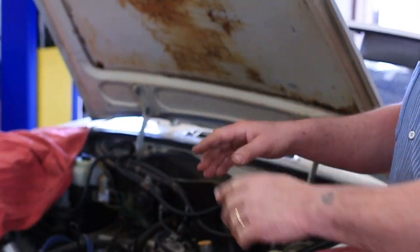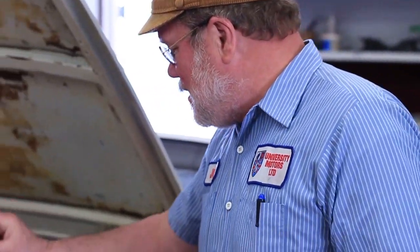You'll remember in an earlier video that I told you that anytime you take the cylinder head off, to put the pistons halfway up their stroke and pour in an amount of fluid on the top. Gasoline works best, but you should never use gasoline for stuff like this because it's dangerous, but gasoline works really well. So we put a fluid, unnamed, into the top of each of these cylinders, and Forrest told me this morning, he said it was like watching a toilet flush, putting it on the number 3. It just swirled around and was gone. So we know the rings are bad.